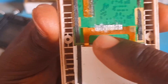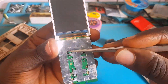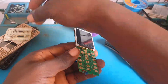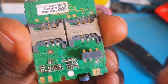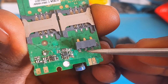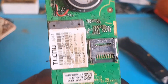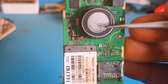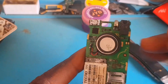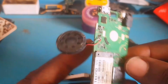Now doing a physical inspection, even without opening the phone further, you can see the phone is having liquid damage or moisture damage. Opening it up, it looks like a technician has worked on this device before, but that's not our problem. There is water damage everywhere — look at the charging section, it also has water damage symptoms right there. Water damage everywhere. So the reason this phone went dead is because of water or liquid damage.